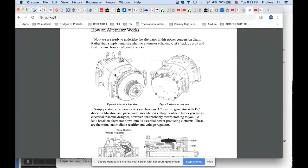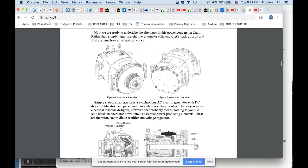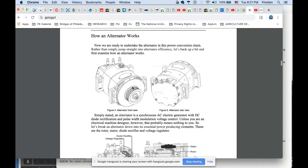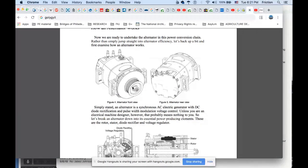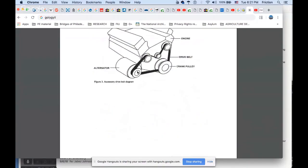If you come to a stop, every time you come to a stop, your car goes to idle. That idle speed is not just about keeping your car running, but about keeping this alternator, this generator, running, to have your headlights on, all this stuff working while you're at a stop sign. So this matters. If you're changing alternators and you get the wrong size pulley, your ratios change.